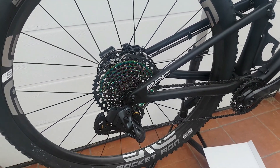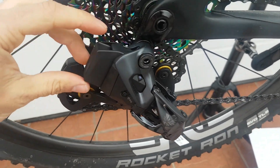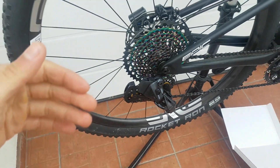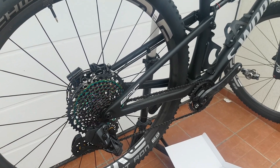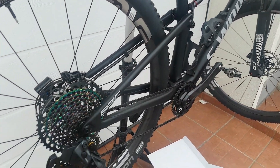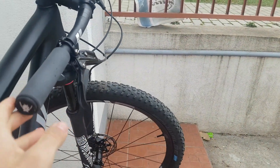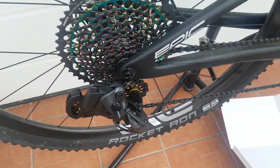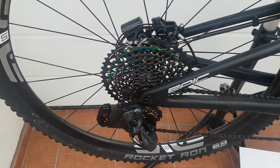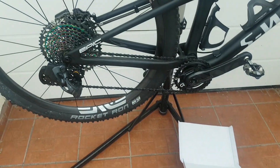I'm sure many of you have already heard about the details, so just briefly: new rear derailleur powered by the same battery that every other SRAM wireless component uses. The setup is super easy — this was probably the single most simple and quick group set change you can make. You just take out the rear derailleur, pull out the cable, take off the shifter, install the new derailleur, install the shifter, pair them using the function button — exactly the same as on the Red eTap — then adjust the limit screws plus the B-gap using this little tool, which is different than on the mechanical. And you're done.